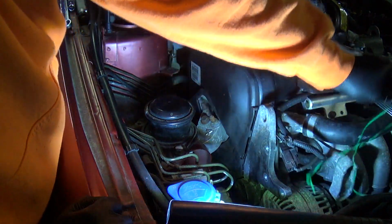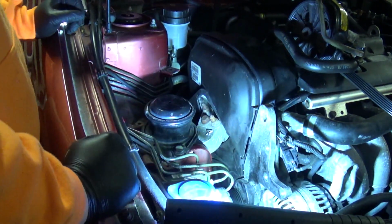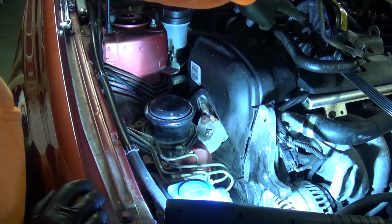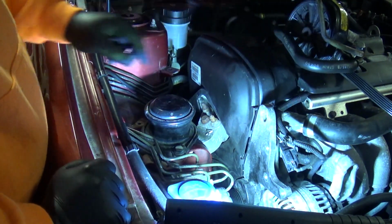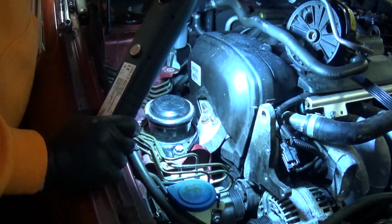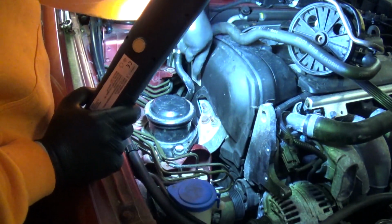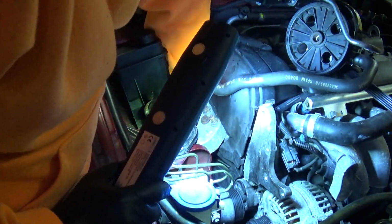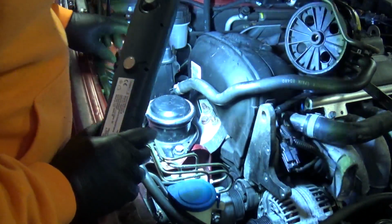Right, remove the remnants of your cam holding apparatus. Right, put the power steering back. I think you can just about make out the pulley on camera. There's actually 4 bolts accessible through 4 holes. From the looks of it, the top right didn't actually need to come out, but again, hindsight. Right, first bring the reservoir around, and this hose that you can see there just coming into view, that actually clips back down there on top of the frame. Just like it's a plastic sort of U-shaped clip sticking up out of the frame.